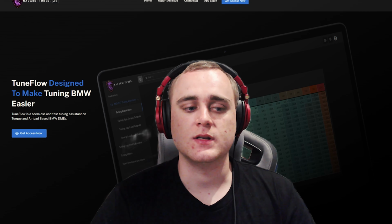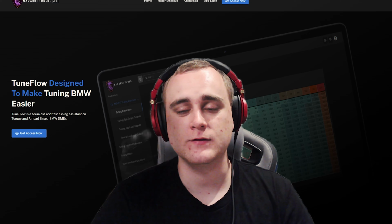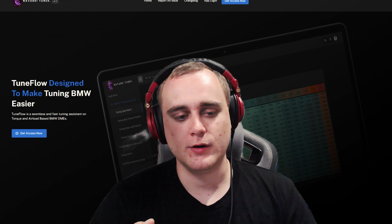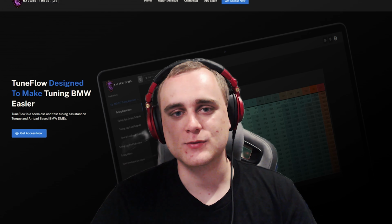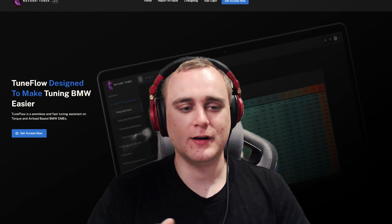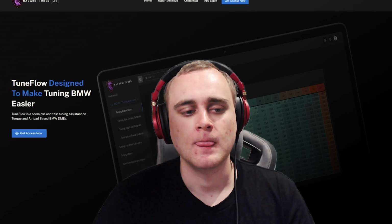That's what Darton recommends. We did it on a 3-axis CNC, which is pretty much the minimum you can install these sleeves on. You can't use a honing or boring machine, especially because we're not machining circular shapes, but partial circular with a little bit of flat here and there. So we need a CNC machine for what we're doing, basically.